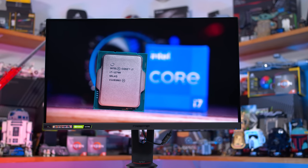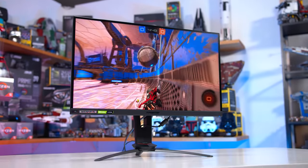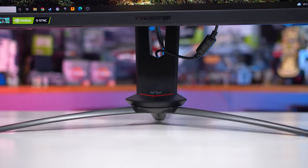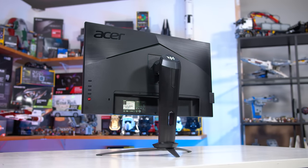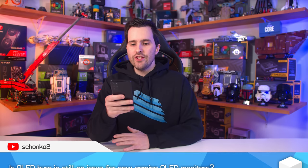The vast majority of monitors today handle that crossover between the minimum refresh rate and the LFC range really well. There are some examples where that's not the case and we call them out for flickering in our reviews, but generally the combination of high maximum refresh rate, sufficiently low minimum, and smooth LFC handling means we no longer have to worry about minimum refresh rate boundaries — which is great, because it used to be quite a painful discussion in the early days of variable refresh rate with 48–60Hz monitors that made FreeSync almost pointless.